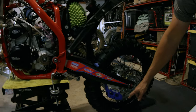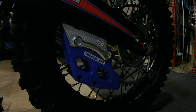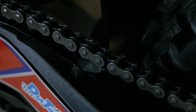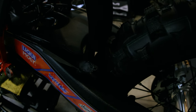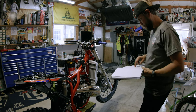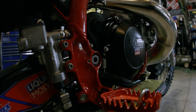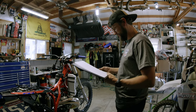The TM Design needed a little modification to get the guard to actually sit in the recess all the way, so I just took the carbide to it and zipped it out. One of my tricks I do: I like putting a little silicone in there because otherwise it's a good spot for dirt to build up, and then if dirt builds up in there, rocks get caught and it's extra hard on your chain — so it might as well fill it with silicone. It's pretty easy to get out, just stick a screwdriver in there. Changed the hardware on the rear master cylinder — those Allen heads are pretty prone to getting stripped out, so I put the classic Austrian hardware in there to make that a little easier.